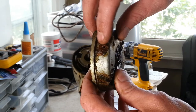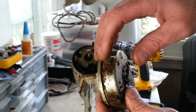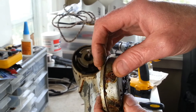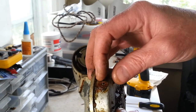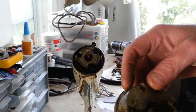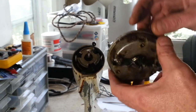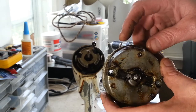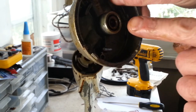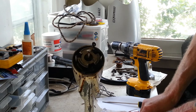And this right here is a cork filler or whatever. It's the hole where you drip the oil into. And this one looks in pretty bad shape, and a lot of times they are. They're mashed or brittle, so we probably just take that out. And when you oil this... Sorry. But when you oil these, you don't have to be as careful as you do with the Sunbeams, because the oil travels down here, and it will soak into these oil wicks that are in here. So that's another nice feature in these HPs.